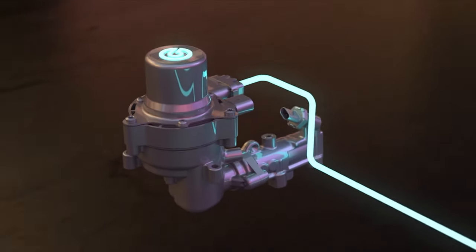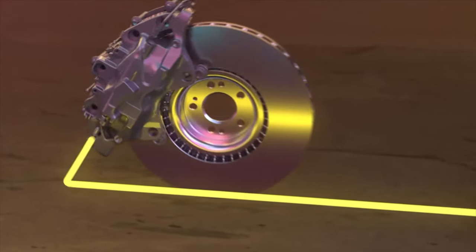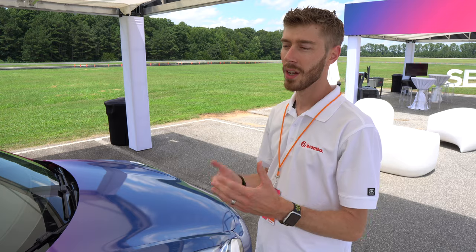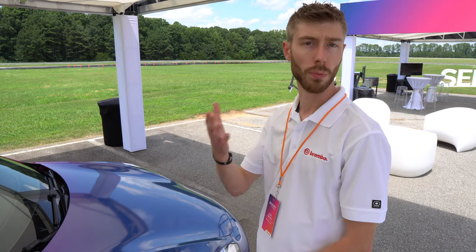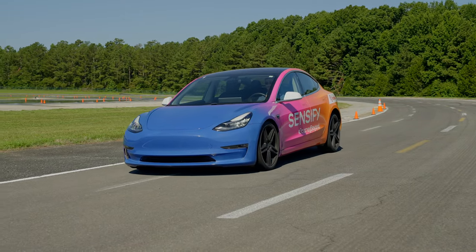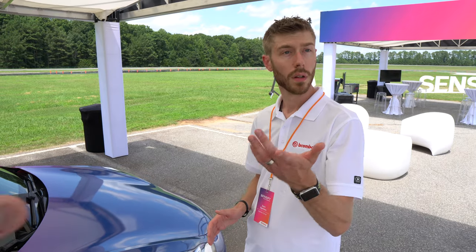The way we do that is with electro-hydraulic actuators — they basically have a little piston that pushes in and replicates what you would normally be doing with the master cylinder pushing pressure straight to the wheels. This decouples the driver from the wheels, which allows us to do a little more control and also gives the driver very consistent and comfortable feedback from the pedal. So it's independently going to each wheel versus the typical mainstream where it's constant amongst all of them.